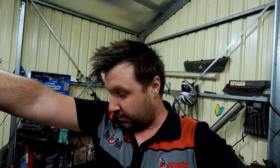So yeah, let me know down in the comments what you guys think I should do, but that's basically where I'm going to end this video today. Should I just save up, fork out the money, get the expander box, put the idle air control valve back on and try and find out why it was defaulting to 50%, which I could probably find with a bit of digging in the map, or do I leave it as it is and give it a try, or go to drive by wire throttle? I'll probably have made my decision by the time this video goes up, and we'll have already tested it. So I guess you guys will see a video about that.